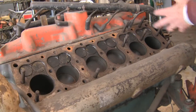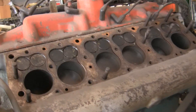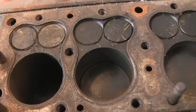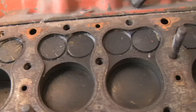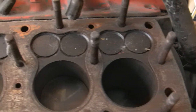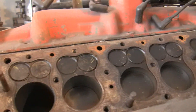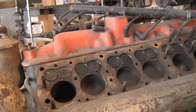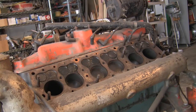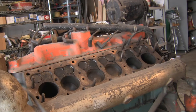This particular engine is a very easy engine to restore. We always pull all of our engines down enough to get an idea of the condition before we start. Obviously no work has been done on this engine — it still has the standard bore. From our inspection of the cylinders, probably a light honing and standard pistons put right back in are going to do the job.